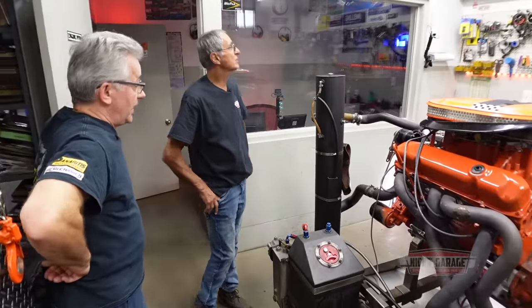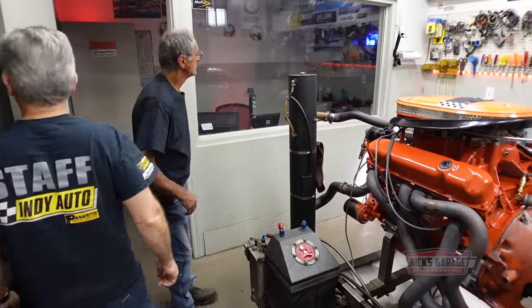I'm ready. Bring down the water. This thing's going to be a handful. I'd like to see 500 torque with that air cleaner on, and at least 426 HP. Where is the HP at? 422.4. And the torque is? 489. I want to see 500.